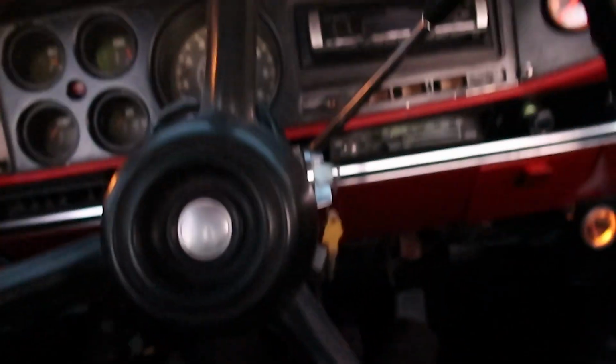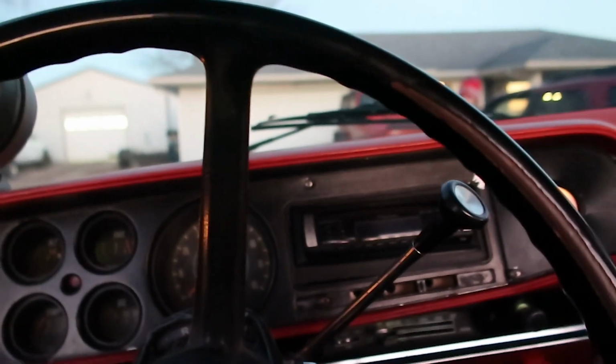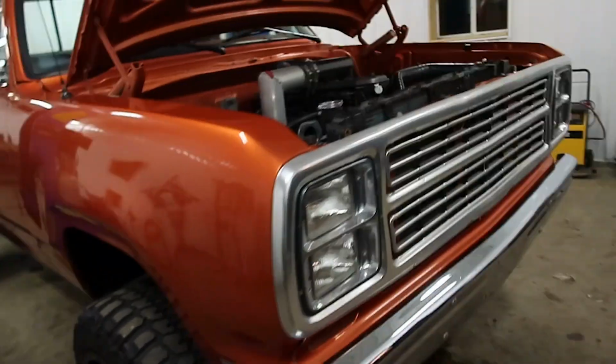Guys, I have confirmed we can do full lock both ways without rubbing the fenders by about a centimeter. So 33s, unless we lift this thing, looks like as big as we're going to be able to go on it for wheels, but because I love just sitting in this thing, it's like a time machine, literally. Love it. Please leave a comment down below what you guys think, chrome or black wheels on the 79.